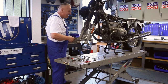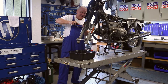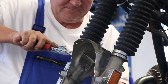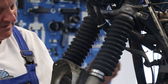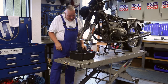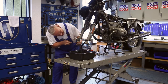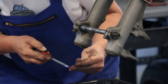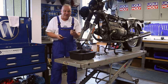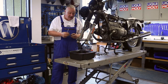Off comes the fender. First I'm going to loosen these clamps here on the fork gators. This one I don't even bother with — it's broken. Underneath here there's a couple of rubber plugs. They're usually pretty beat like this one is, but they're included with our fork seal or fork rebuild kits, so you get a set of these new plugs with that.